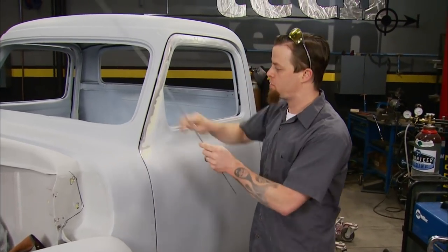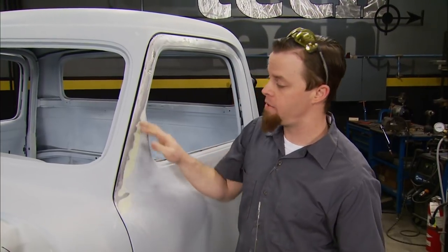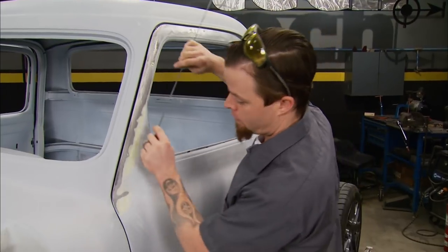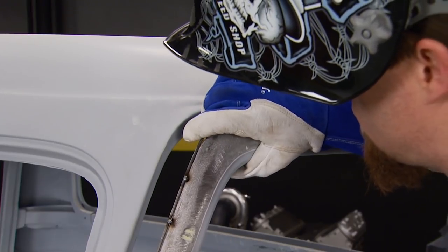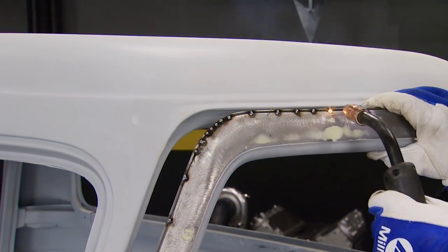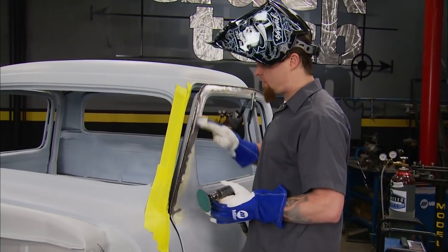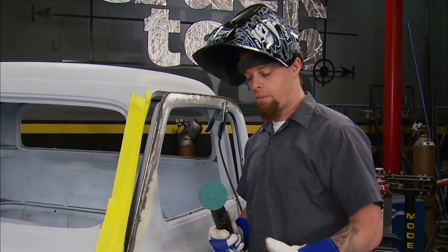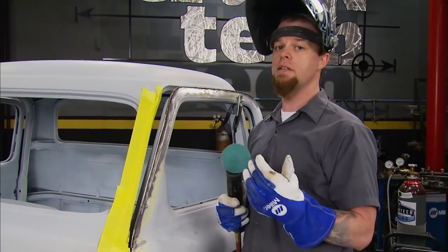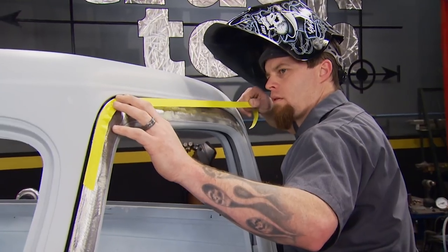I'm going to use this eighth-inch steel rod to close this gap. It fits the door edge almost perfectly, and once we weld it in, we'll have a good solid foundation. This is way better than a build-up of filler, which will bust on you down the road. A good tip is to bend the rod as you go — the heat created helps bend the rod while you're welding, making it nearly effortless. Once we're all welded up, we grind down the welds with 36-grit on an angle grinder. You want to move around a lot because grinding also causes heat that can warp the metal. Our gap is almost perfect at the front of the door, but a little tight up top, so I'll pull an even tape line to know exactly how much to grind away to make it uniform.